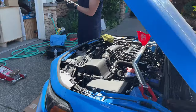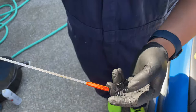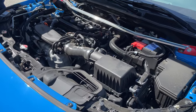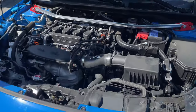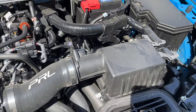Check the oil dipstick — it's about almost halfway, which is good. You want it in between. For this 11th gen Civic, the oil capacity is only 3.7 quarts, so we were pretty much on the dot with four.